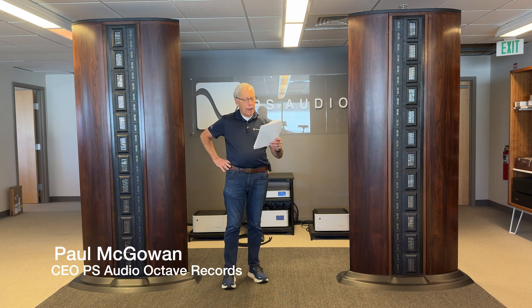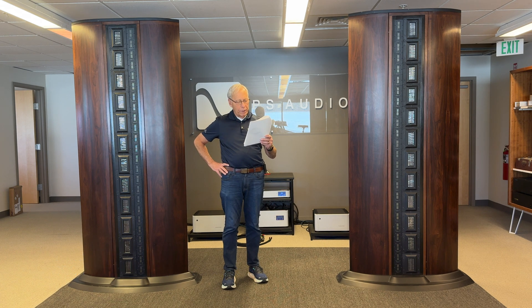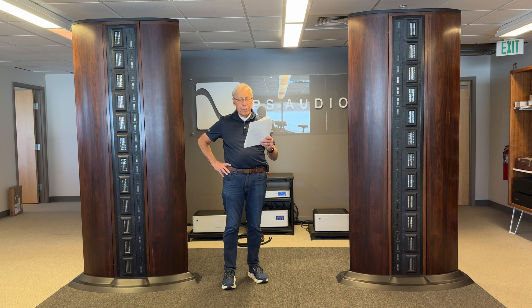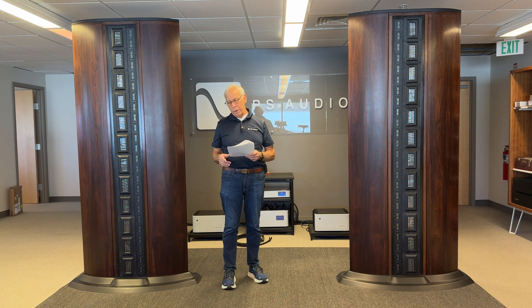Jeremy in Toronto writes: I recently found an inexpensive SACD player, a late model Sony, and I thought I'd enter the world of DSD this way. The player has an optical out and a multi-channel analog out, but I was surprised to learn the optical out did not transmit the SACD layer information. Given this, when listening to hybrid discs that contain two-channel audio, would I be better off listening to the PCM CD layer through an external DAC, or the DSD SACD layer as converted by Sony's internal DAC?